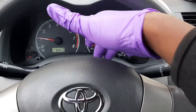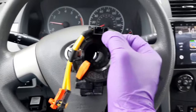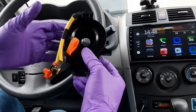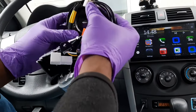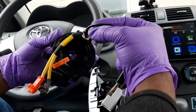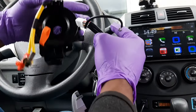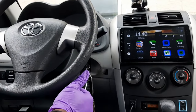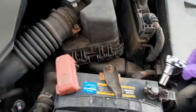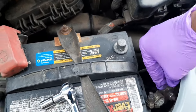To do this I'm going to have to replace the clock spring. I'm going to take out the airbag. I got the clock spring on eBay. The reason why I'm replacing the clock spring is because this new one has pins to accommodate the steering wheel control button — the one on the car doesn't have all the pins. If you have another model like the S or XRS, you might not need to replace the clock spring. I'm only replacing it because I have the LE model. First thing I need to do is take out the airbag, and to do that I have to disconnect the negative terminal of my battery.